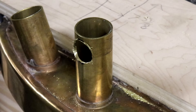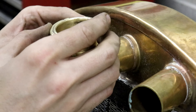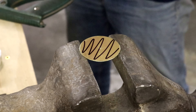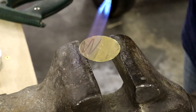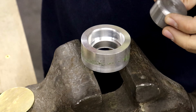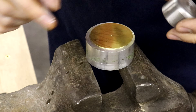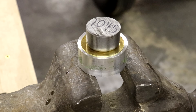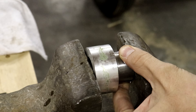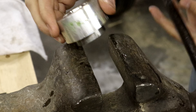What I'm doing here is finishing up some details I didn't get to last time — finishing up the fill port here. I just cut a hole in the fill port, and I'm going to make a little cap that will plug it up and get this mounted onto the frame. The real goal of this video is to figure out if this radiator is actually capable of keeping the engine cool, because when I made it I was working in some pretty tight constraints. The original radiator from the engine was too big, so I ended up using the same core but needed to shorten and narrow it pretty significantly, so it has much less area and volume than it used to. If it's not able to keep the engine cool, that's obviously a really big problem.